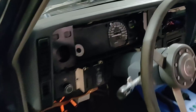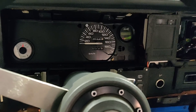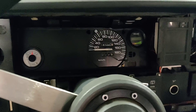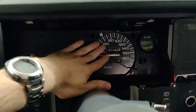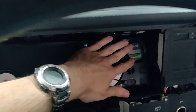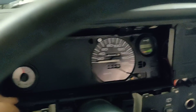We'll look inside at the dash. I had to do a bit of a custom dash here because obviously we don't have things like oil pressure or engine temperature — instead we have motor temperature and controller temperature. The speedometer is still the same — it's actually mechanical and hooks onto the transmission, so it works completely the same. This gauge here is basically for the controller and will show RPMs, voltages, and temperatures for that controller.